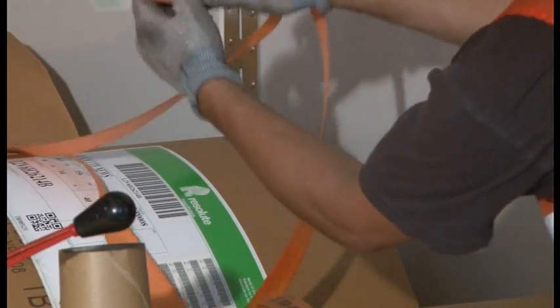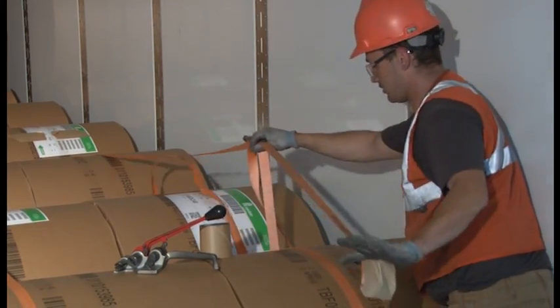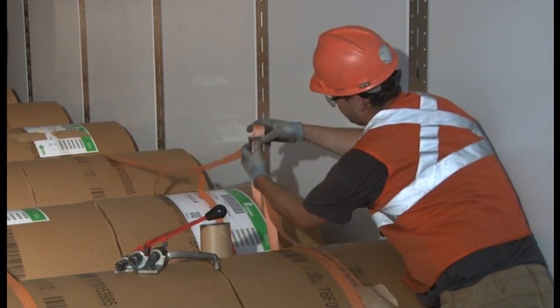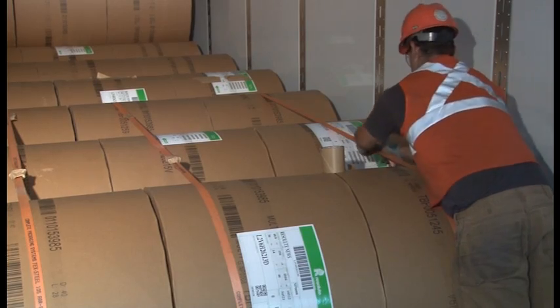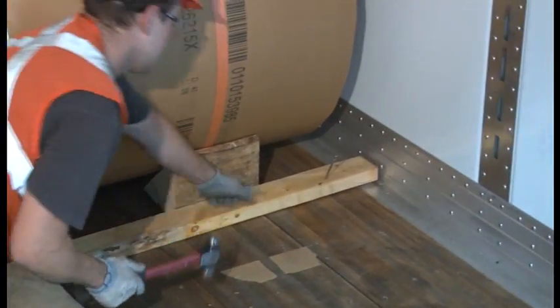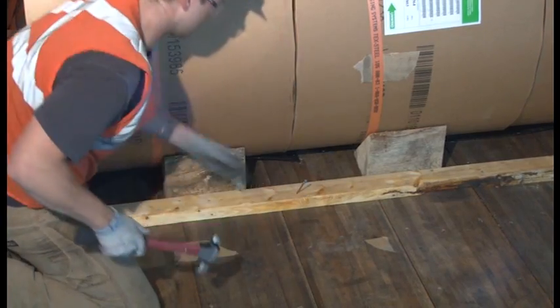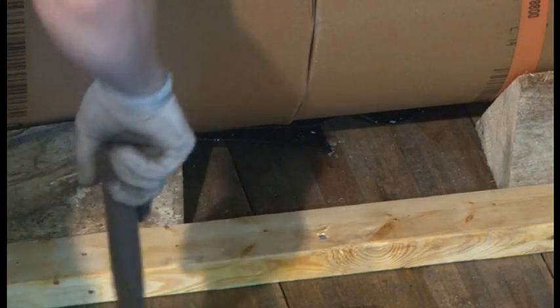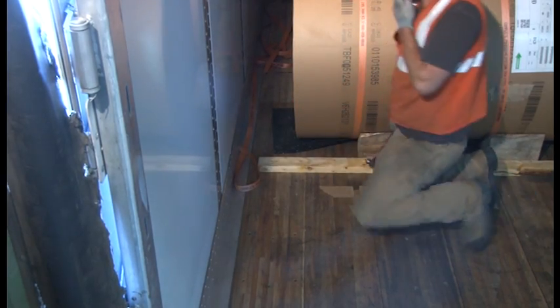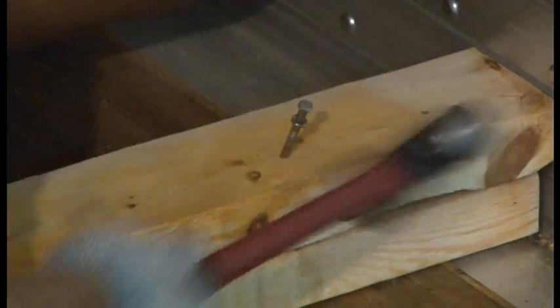Hold the clip with the open arms on top. Take the strapping and fold it back creating a loop. The end that is to be cut will be on top. Push the loop up through the bottom of the clip and over the nearest open arm of the clip. Pull it tight. Repeat the process with the strapping from the other side — loop up through the clip and over the open arm of the clip. When the gang strapping is in place, the last row of the load must be blocked with 8x8 wooden wedge blocks, not the cardboard ones. Now nail a 2x4 to the floor of the van to hold the blocks in place. Start the nails at an angle away from the roll so you do not hit the roll with the hammer. This will also help to suck the 2x4 in securely against the wedges. Hammer the nails home on this one as you will be placing another 2x4 on top of it. Use 4 nails in each 2x4. The nails of the second 2x4 do not need to be flush. Leave them so they can be removed without difficulty at the van destination.